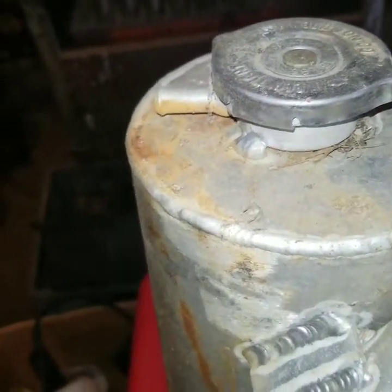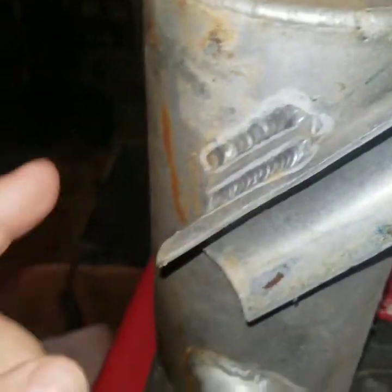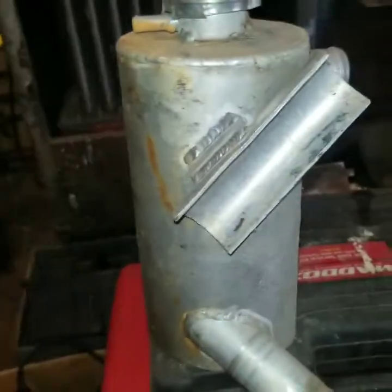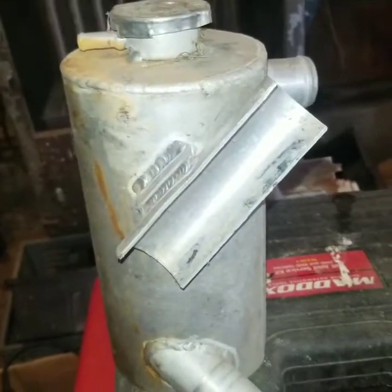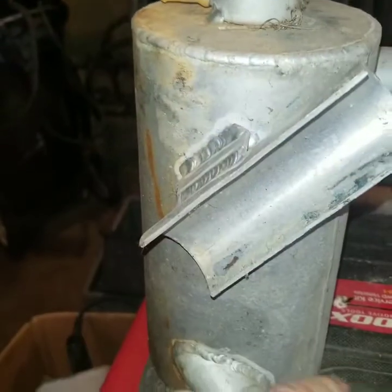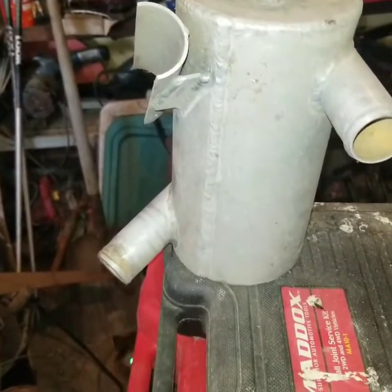What would happen is your coolant will expand; you would probably start out with this full and as coolant expands it'll push water out. It would only push it out to a certain extent, then this whole chamber could end up filled with vapor — but it would be a vortex, so all the vapor stays in here and only water comes out to the radiator. Ideally you would have a separate surge tank to separate out that vapor, with no radiator connections, but I just wanted to take a couple minutes and explain how that works.